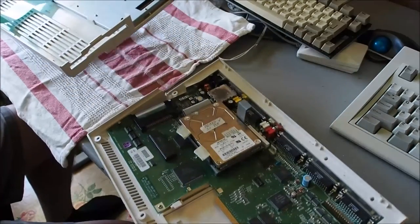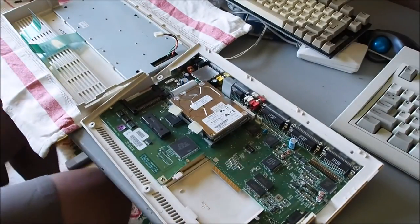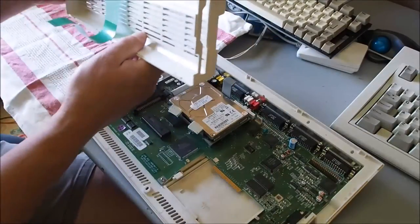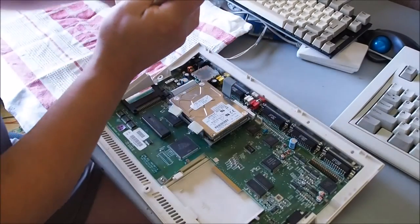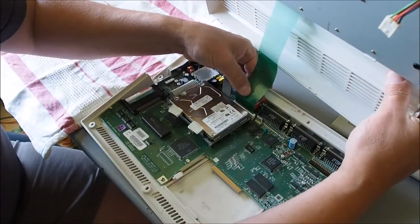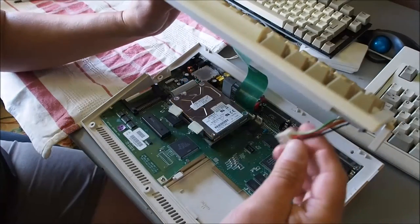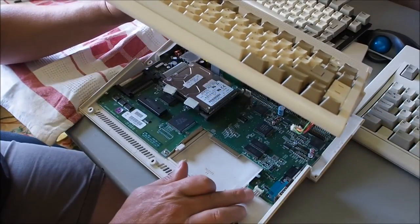It's ready to attach back onto the computer itself. You'll notice the floppy drive is missing from this machine - I don't quite have enough floppy drives for the computers I've got; I'll probably end up buying one. First of all, make sure that the ribbon keeper is sitting up, then install the keyboard ribbon and push down the keeper. Don't forget to plug in the LED connector into this connector here.